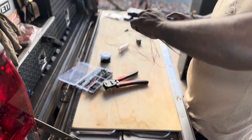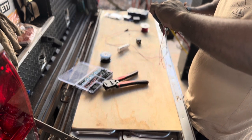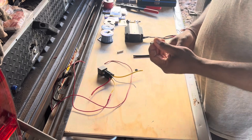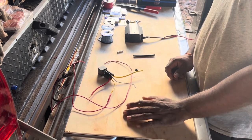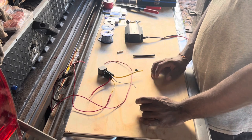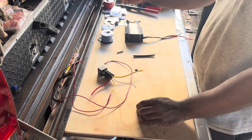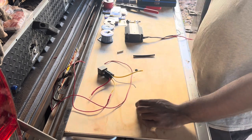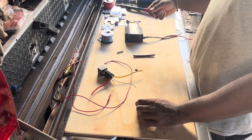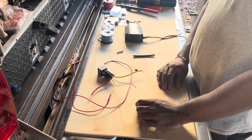I'm using this marine heat shrink so no moisture goes inside, in water or anything — it's really good heat shrink. So I've got these butt connectors, and first I'm going to make a wire harness. Once you make the wire harness it's pretty easy. I can keep mounting the back of my drawer system, then run the wire to the battery and cut it when I reach there.